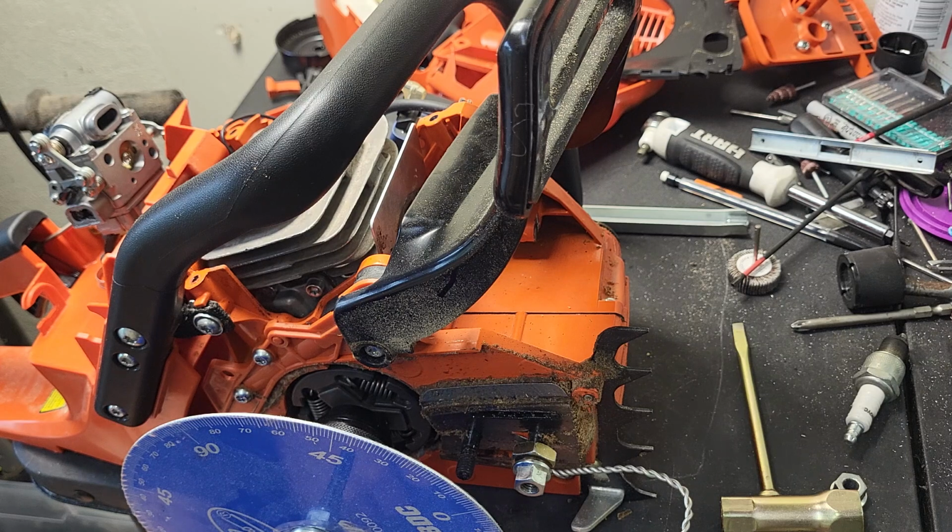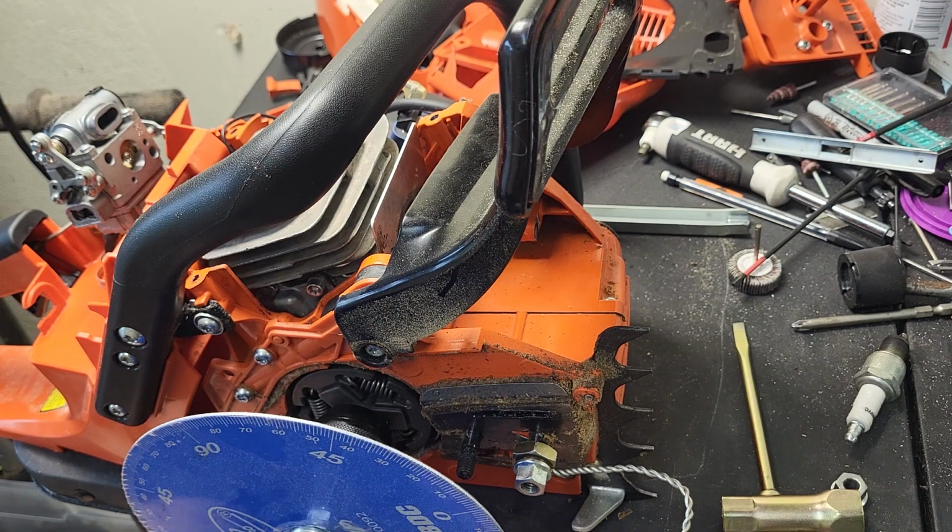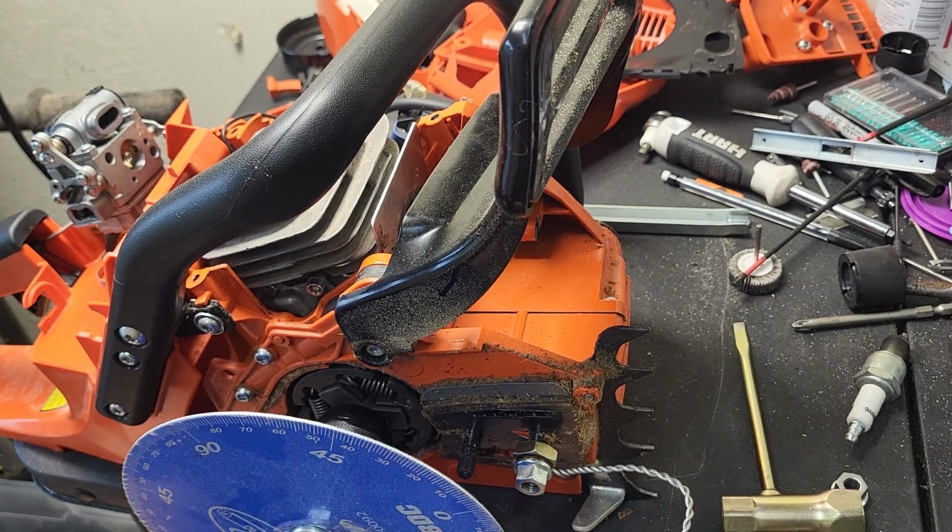Yeah, so I need to try and set my transfers for 118.5. Gonna leave the exhaust at 105, try a short blowdown build, which I'm not sure if the blowdown matters a real significant amount or if it's just port timing that matters. But that's why I'm trying out different people's advice, just to see where things go, how they end up.